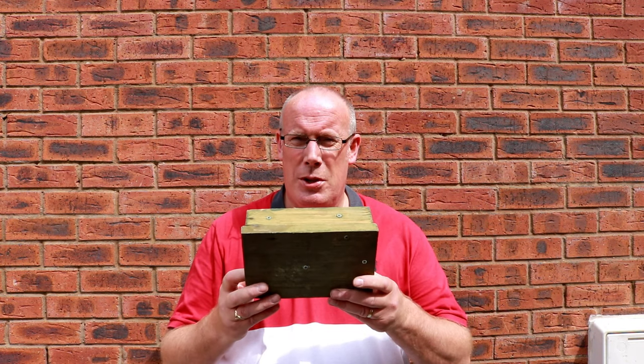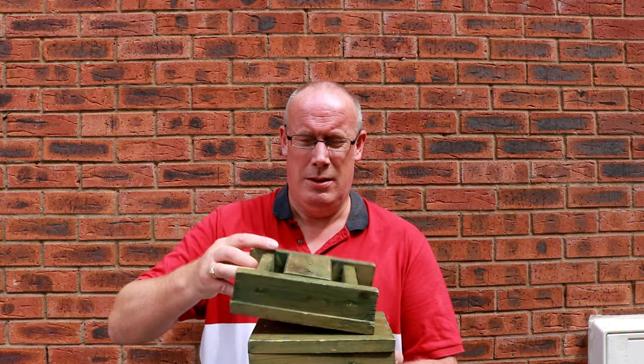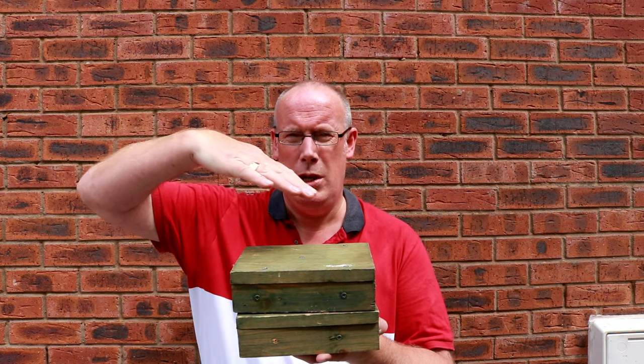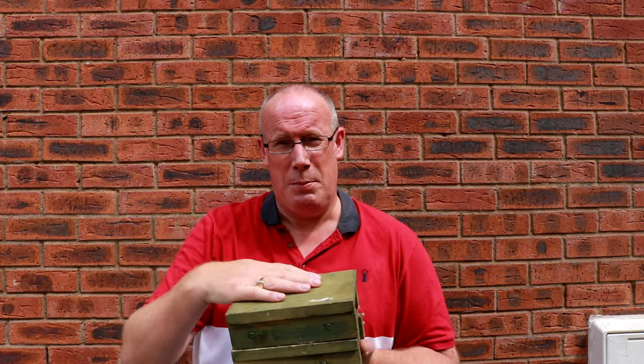Top tip number six. Sometimes when you go to site, the ground isn't perfectly level and it may be on a bit of a slope like that. So when you drop your legs, you may be short. So I had some spare wood and I made myself some of these blocks. When your legs are fully extended, you can add these blocks — I actually made four of them, just with scrap pieces of wood. So if you've got any scrap wood, make yourself some blocks. When you are on a pitch that's not perfectly level and you've fully extended your legs, you can use these to raise the ground up so your leg will sit nicely on top. Top tip number six.